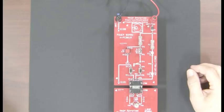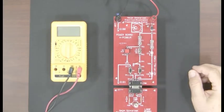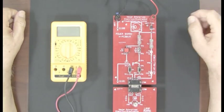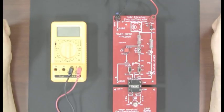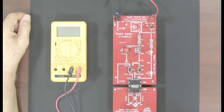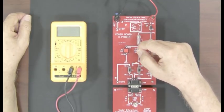I'll put the book aside and bring the meter into the picture so you can see the readings as we take them. We'll cover several points of troubleshooting that are also covered in the workbook. Watching this short video will help you get started a whole lot quicker. Now the circuit is powered up but not on — notice the lamp is not lit. I'm going to turn the lamp on by toggling the ignition switch up, and you see the lamp comes on.